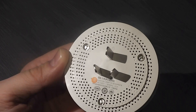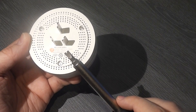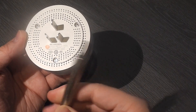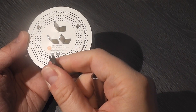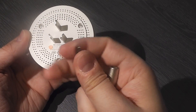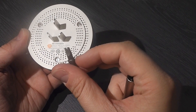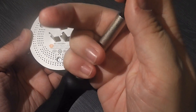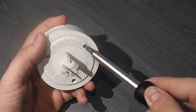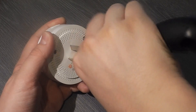So you'll need a screwdriver with a little slit in the middle. You can either buy one or make your own. As luck would have it, here's one I made earlier — basically a cheap little IKEA hex bit with a bit that I cut down the middle with a hobby saw. I did catch my finger while doing that, so be careful — DIY, you're gonna injure yourself every now and then. But let's start by removing some screws. Obviously this will void warranties, but that's what we do, right? If you can't open it, you don't own it.